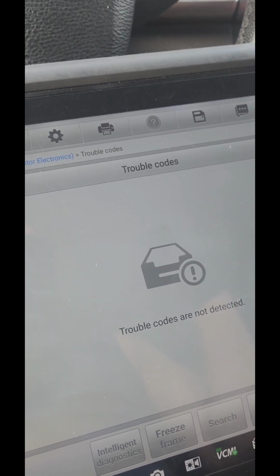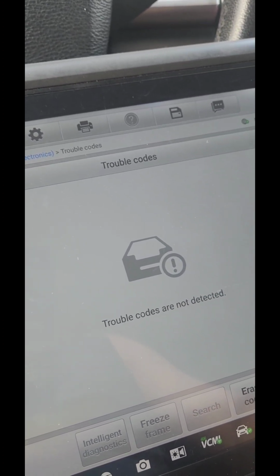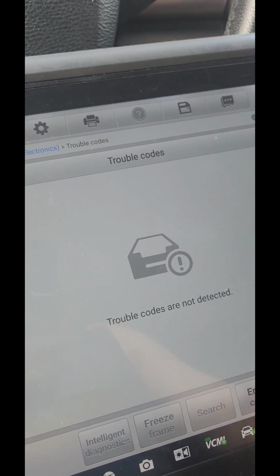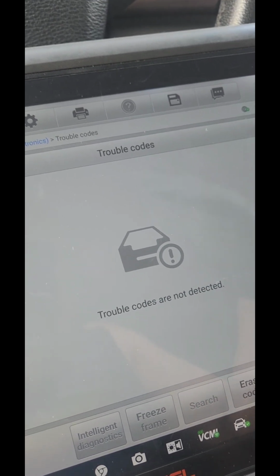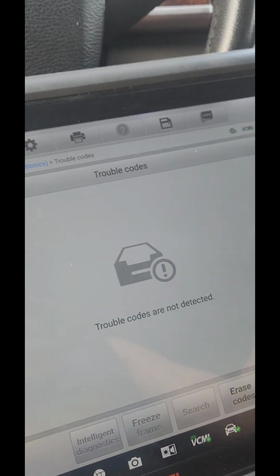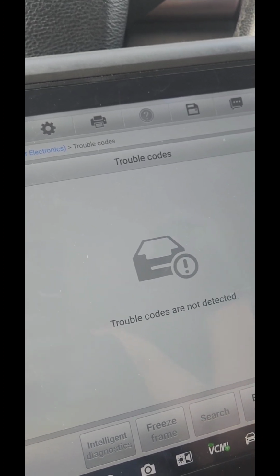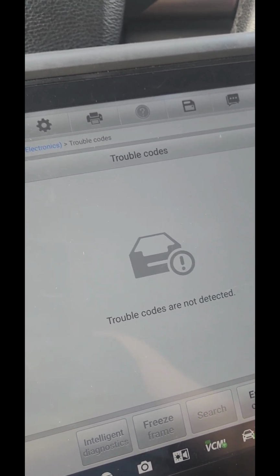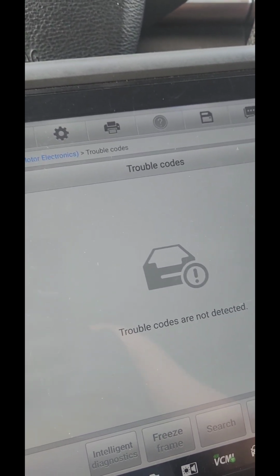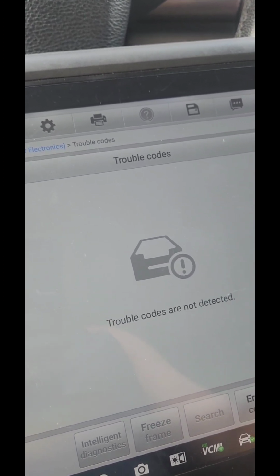Like I said, the engine was sucking air from that thing, too much air, and that's why I was getting that lean code. Lean means too much air, not enough fuel. It could be your fuel pump, the mass airflow sensor, a bunch of things. But what you first have to do, when you have a code like that for that type of pump connected to the canister on the fuel tank, is consider that the engine is going to be sucking a lot of air, or that pump is putting out air that is not supposed to go into the engine.